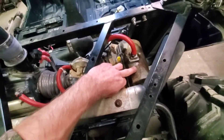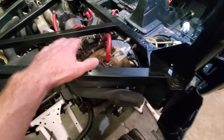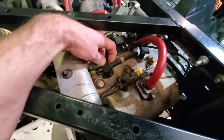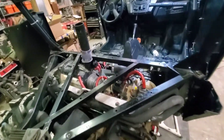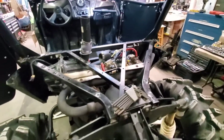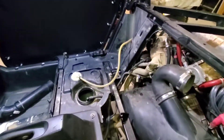As you can see I got everything removed. I'm going to take this valve cover off and see what's going on with all that noise. Hopefully it's just a loose rocker arm or something. I did a compression check and noticed one plug was very black — burning more fuel than it should. Compression was good on both cylinders, above 90 PSI, and didn't leak down at all after a couple minutes on either cylinder.